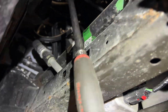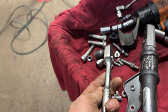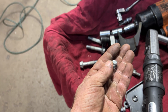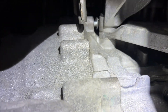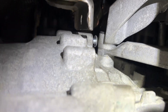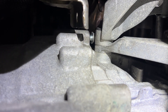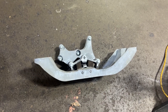I always try to turn it clockwise. This is what I'm using to take the nuts off. Here's what the torque converter nuts look like. I think there are 6. Ford engineers have put this bolt coming in the wrong direction, and they've made it so you have to twist that bolt out as you're pulling the transmission. It's on the right side. Other than that, it wouldn't be bad. I removed the rear mount.